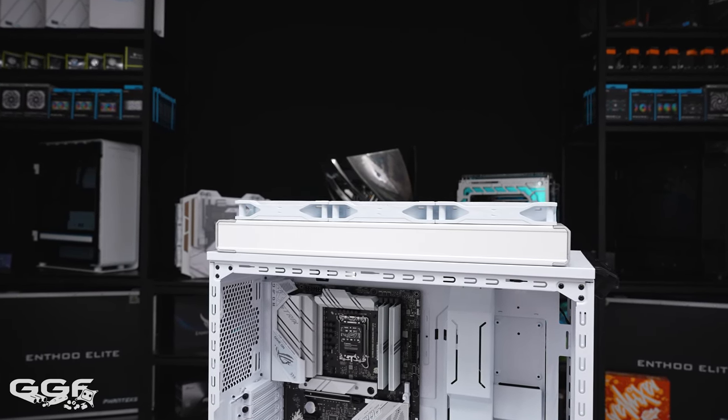The hard drive bracket is borderline a problem. Hard drives normally come with three sets of holes — top, bottom, and middle. Be Quiet's bracket uses the top and middle holes, but all my test WD and Seagate hard drives had no middle holes, so I could only use the top set, leaving the drive unsecured. You might say 'who uses hard drives,' but I have to think of everybody. The alternative hard drive spot requires purchasing separate Be Quiet Hard Drive Cage 2 trays at $18 each. So if your drives don't have the middle hole, you can't really use either hard drive location without extra cost.